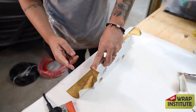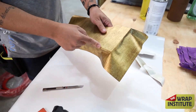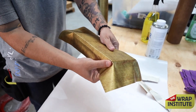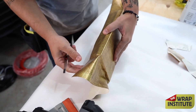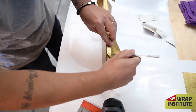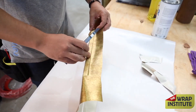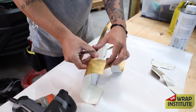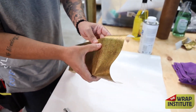Notice he has a liner on the work table, which lowers the surface energy, making it easy to pick up that high-tack interior film from the surface. He hits the bottom with heat, which triggers the memory of the film — that memory was built in, so he didn't stretch it at all, zero stretch. He lets the material wrap itself on the outside, then makes a relief cut at the bottom about an eighth of an inch on the underside. He wraps all sides, makes a super straight cut right on the body line, picks it up so it's nice and uniform to the top edge, pulls just enough to create tension, then makes a tiny cut at the end to ensure it releases clean without tearing.